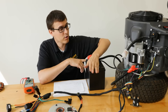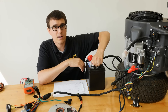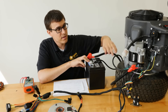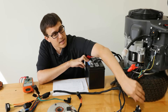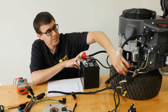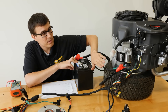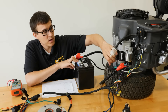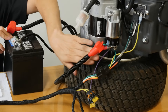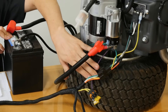We have a ground wire that goes to the engine — these are sturdy solder-dipped battery cables. The positive goes to the starter. You may have a solenoid beside the starter instead of going straight to it, but these are your main connections. Nothing will work correctly if either of these are loose — they have to be well connected. Then we have our wires going into the harness: the ground of the harness and the battery positive to the harness.